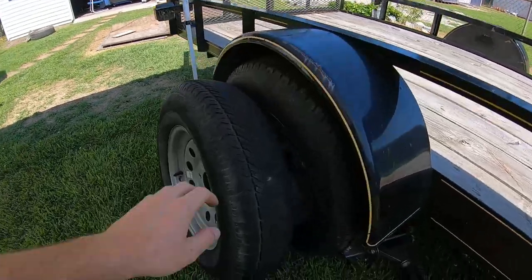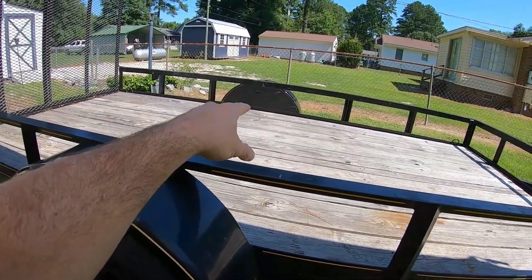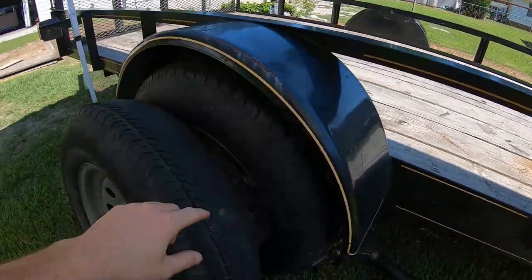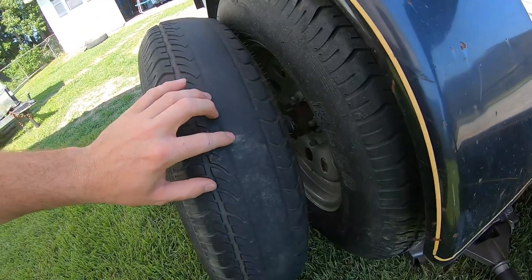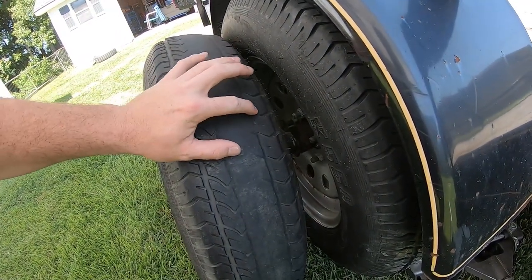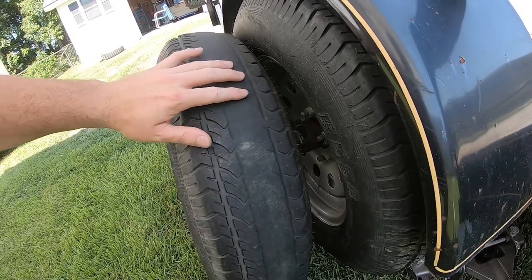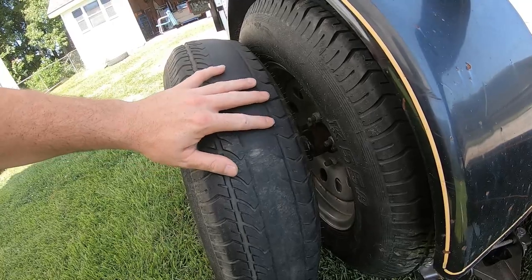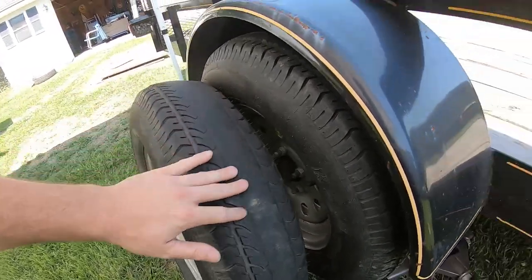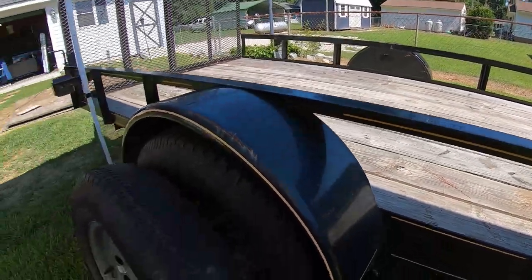Let's look at this first one - it came off the other side, I've already pulled it off. I had a trip planned for last Friday that I didn't take because I didn't feel safe using this. As you can see, there's no tread here in the center and the inner tread is about gone. No belt showing, but it was about a two-hour trip one way, so I went ahead and replaced that one with a new one for now.